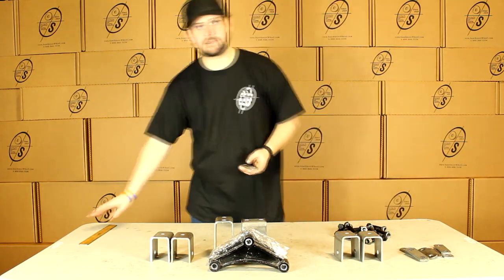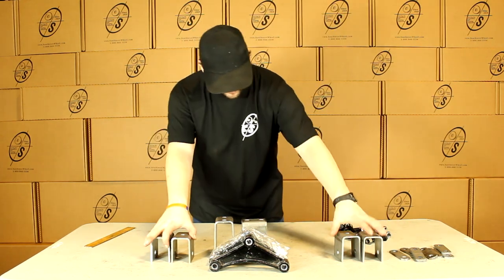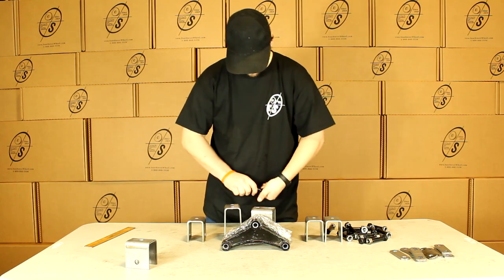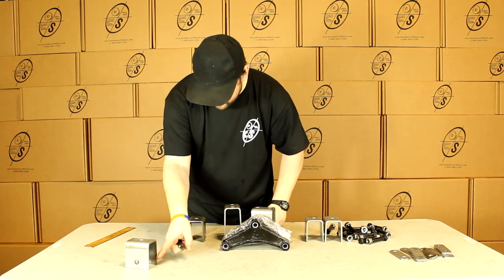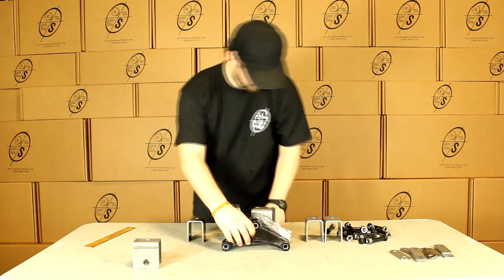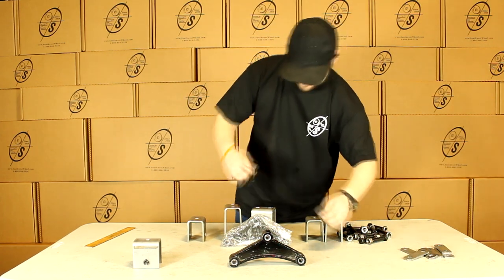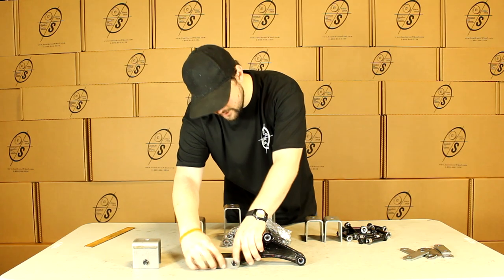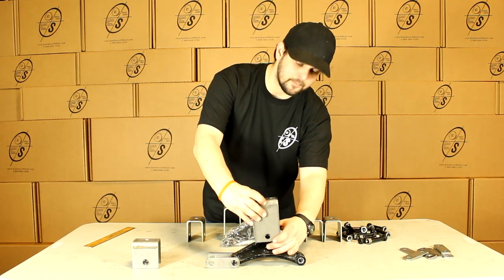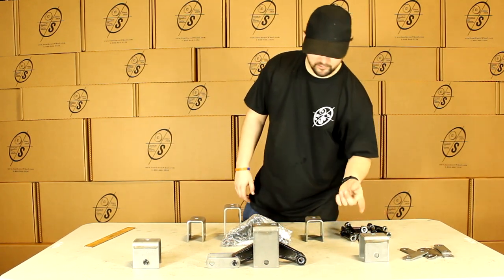Now the shackle straps are going to be roughly two and three quarters from center to center. The way that we bolt these up: we're going to have your front one — your spring will pop right into your hanger, throw your shackle bolt through, you'll throw your locking nut on, and you're going to have your equalizer and your shackle strap. So you put your shackle strap through — go through right here — have your other shackle strap, and then you're going to put your spring right here, and this will attach right here, so it's going to be hanging like that. And then you will attach the other spring to this right here with your shackle bolt.